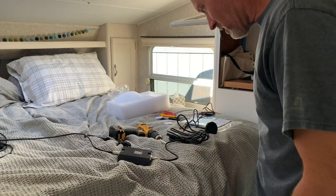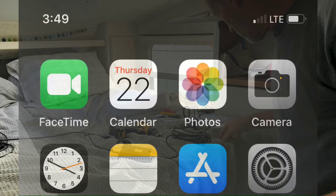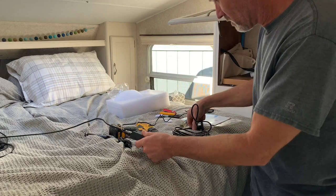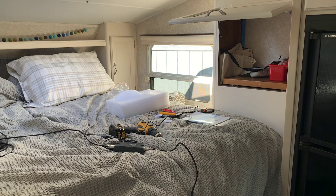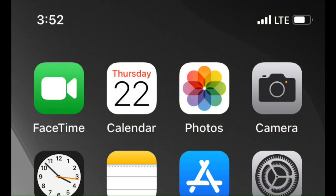Before I plug this in, I'm going to check my signal — I did a screenshot and I've got one bar. I'll go ahead and plug this in and bring the antenna over here. You want to have about six to eight feet between the outdoor antenna and the indoor antenna. I'll do another screenshot. Yeah, that was a pretty significant difference between having the booster on and with it unplugged. So I'm going to finish this installation up and then we'll do a final test.